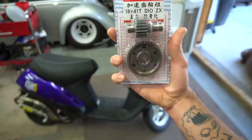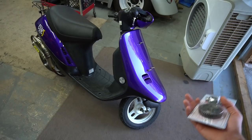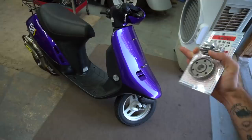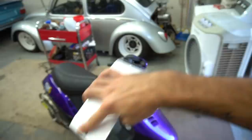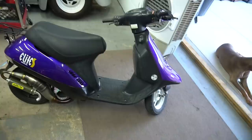Got 9-1s in there right now. Cole has 8-1s in his, but we're stepping right to 7-1s for a more top speed setup. It's kind of the same process if you were to do this on any motor — change the gears and you get more top speed. Yes, it's going to take away from the bottom end, so the initial pull off the line is going to be a little different. You're taking your power that would top out early and dragging it out more, allowing the gears to keep going. Once your gears are going, you can hit 60 and the motor still has time to pull without over-revving. That's the purpose of this — let's get straight to it.